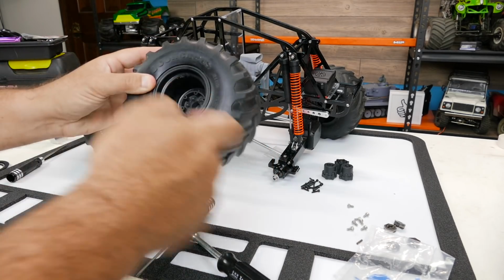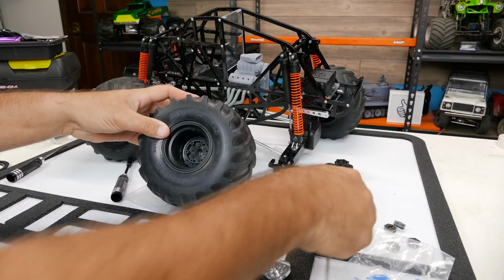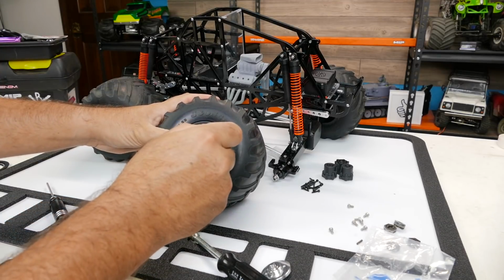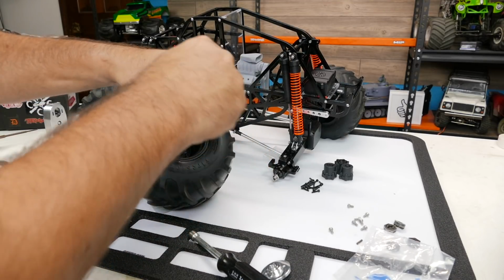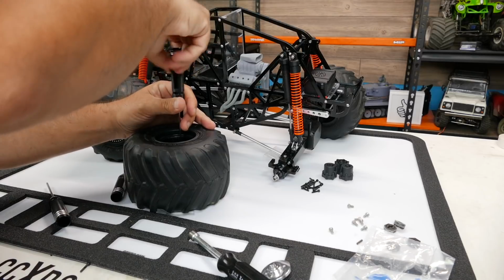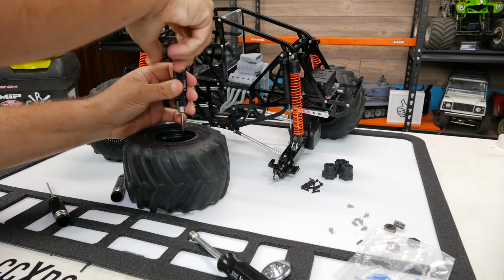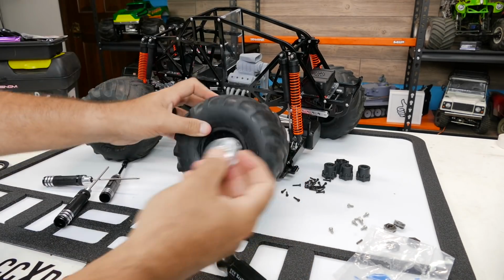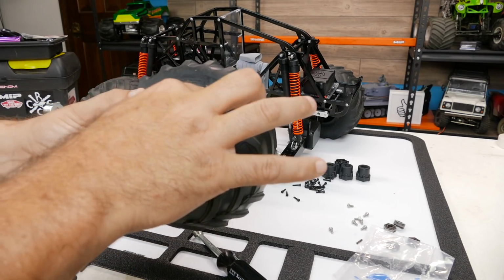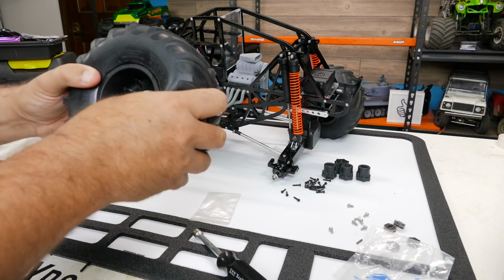So we're going to put this on, which basically means removing 6 of these Allens, and then putting this on with the included screws, which are a little bit thicker thread. Unfortunately, I cannot find my bit for my electric drill to remove them, the 2.0 millimeter, so I've got to do it by hand, which is not fun. When I go to the other ones, it's 2.5 millimeters, so that's a little nicer. So it's just a little bit of extra work. Basically, it's got the opening, and you push this little raised piece and line it up. It's real simple. Lines up and snaps in place.